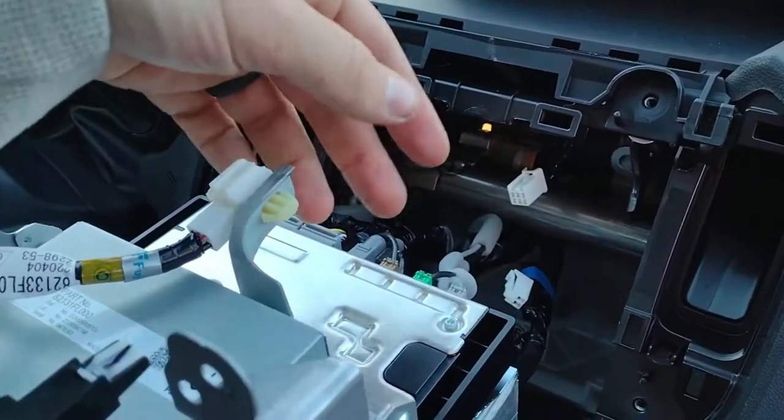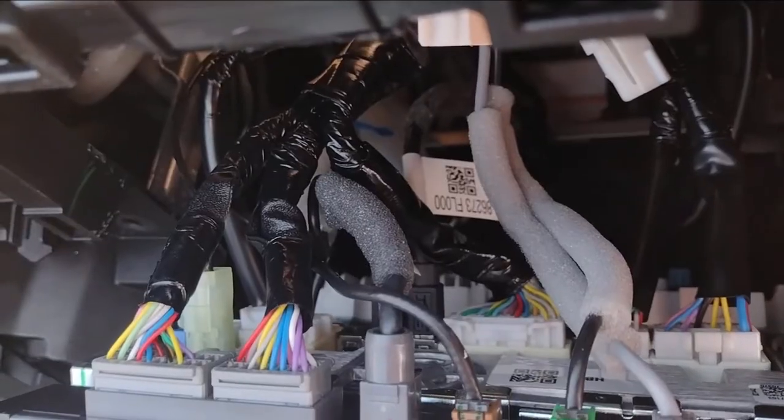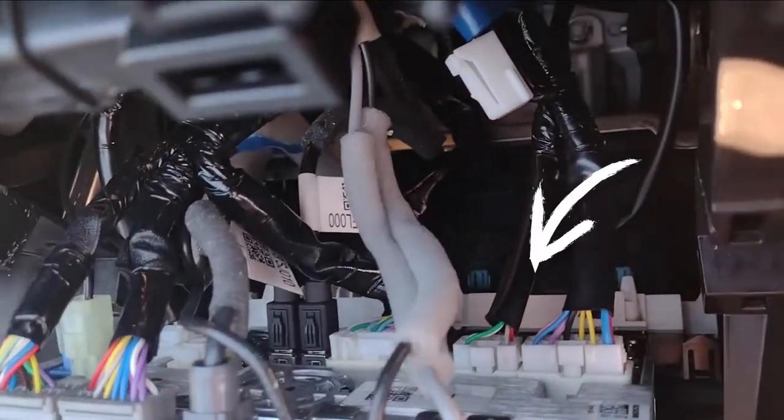Getting the head unit out wasn't difficult once I removed the top connecting set of wires. That was difficult, but once removed it made it much easier getting access to what I need. Once in the back, I tapped into the rear speakers located right here. I had to test the continuity of each set of wires, because finding wiring schematics or diagrams online is an absolute joke. Some other videos on older Crosstrek models had completely different wire colors, so be very careful. Don't just start tapping into stuff or cutting wires — know exactly what you're cutting into. This honestly took the longest: finding which wires to tap into.